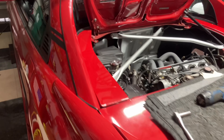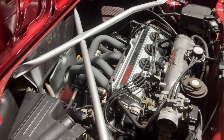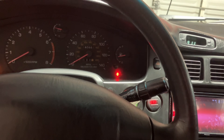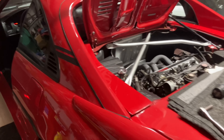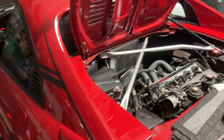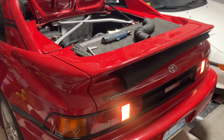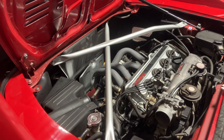New switch is installed. I've got the starter connected so I gotta put everything back together and then test it. I'm so confident this is going to work that I'm going to put it all back and show you the moment of truth. I went ahead and put the air box in. Key's going in the ignition, throwing the car in reverse — and there you go, we have reverse lights! That switch was the problem. Easy way to fix your reverse lights — it's not always the bulbs, especially if both go at the same time.